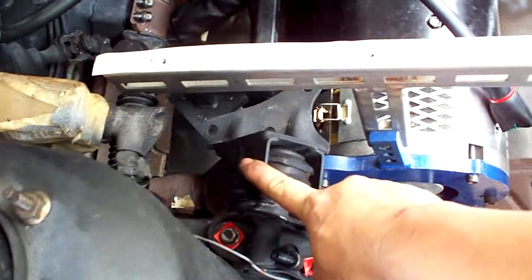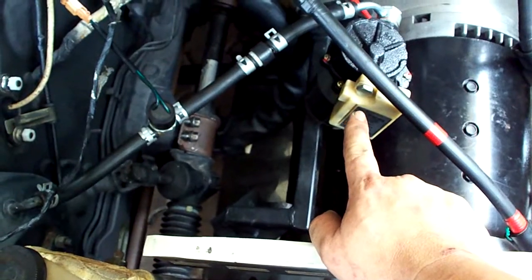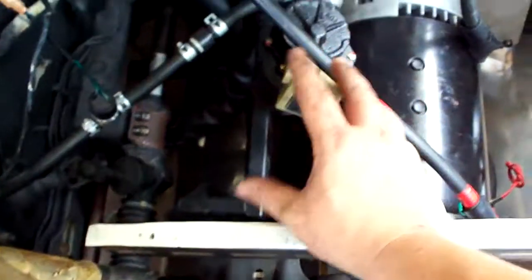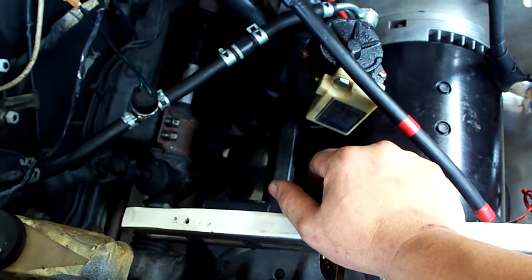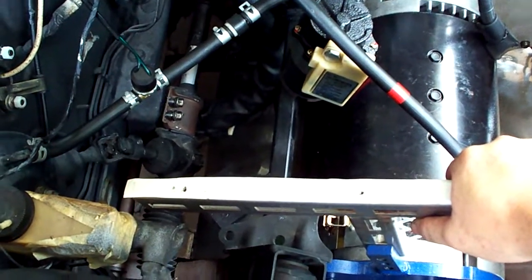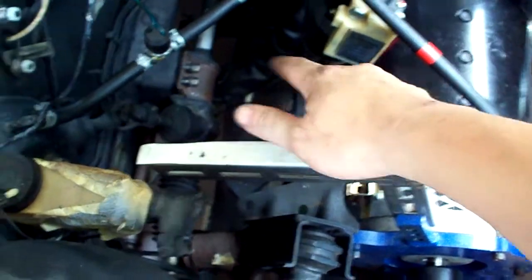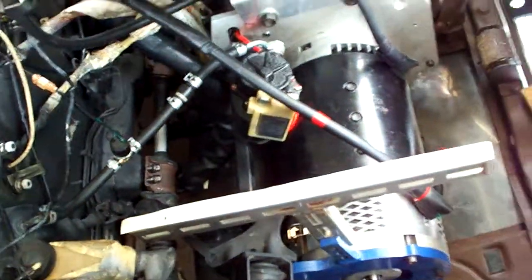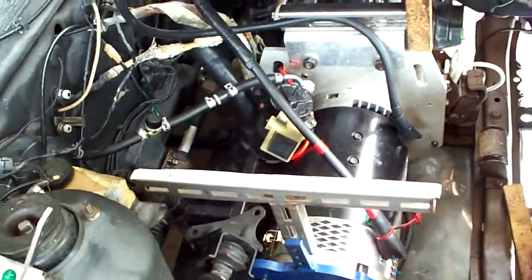With that I'm adding in another engine mounting, and I'm also going to replace the mounting point for the vacuum pump, as I can see the acceleration torque caused the motor to turn quite a little bit. So I decided to remove all the top mounting stuff, put it all down there, and make a new attachment for the vacuum pump.